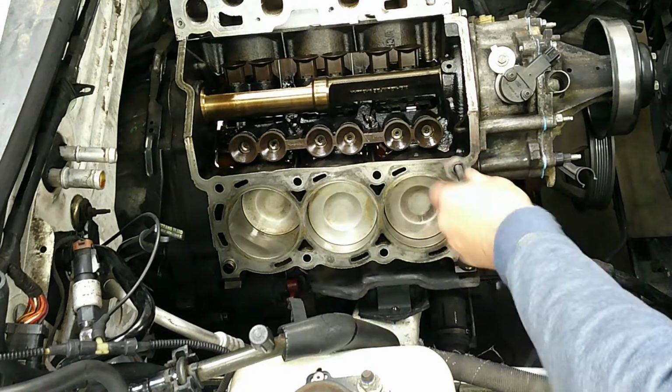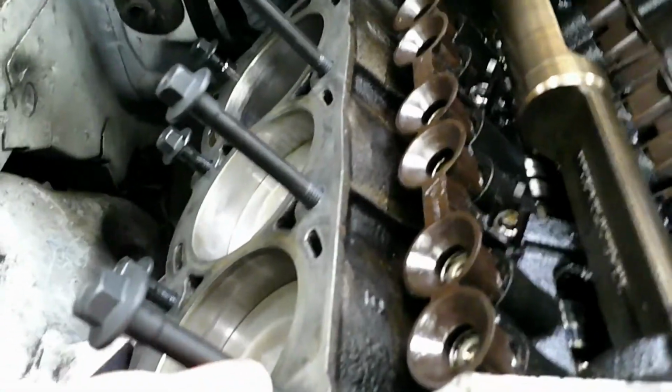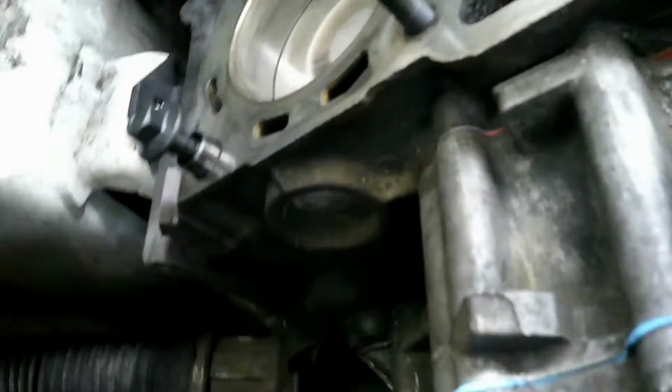If not, you likely have some debris in the holes, and you'll either need to blow them out or clean them out somehow. Once you have all the bolts threaded into where it bottoms out, make sure that each of the bolts are displaying about the same number of threads to ensure that they've all bottomed out equally.